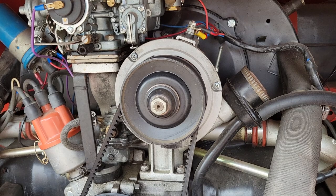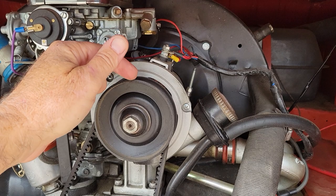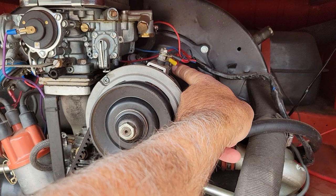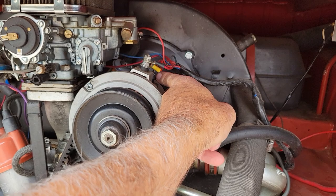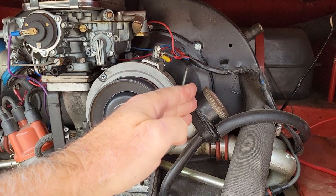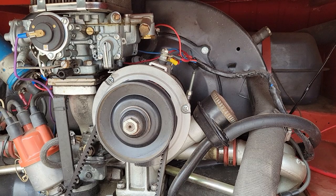So when you do the bulb check and you go to drive your car, you better start looking to find out what is wrong. If it's a bad bulb, change it. If it's a bad connection back here somewhere or up at the speedometer, fix it right then. Because what happens is you turn the key on, you've got positive on one side and the ground is grounding through here, so this is getting a little bit of power when you turn the key on. Then when you start the engine, after a second the light goes out — that has energized this lead. This lead got a little bit of positive for a second, and that tells the alternator it's good to go and start charging. If it didn't have that, it would discharge the battery overnight. That bulb on the dash is the on/off switch — if there's a bad connection, if there's something wrong, your alternator is not going to work.